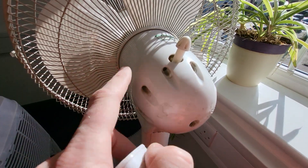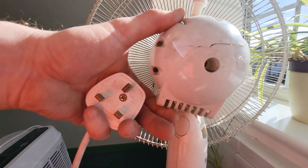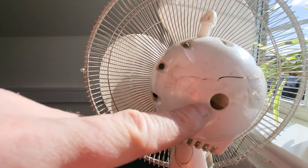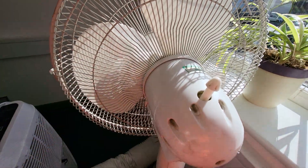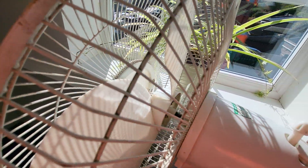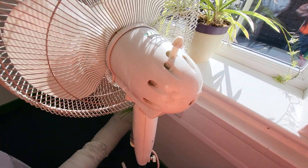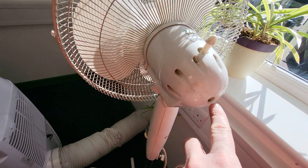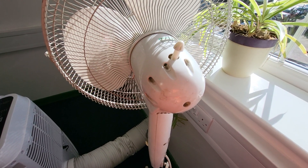You can see here it's all plastic. What you sometimes get is a screw in there which is screwed straight into the motor inside. Now when you test some of these fans, what you'll find is sometimes — about 50% of the time — you can get an earth off of that screw in there. Other times you can't.